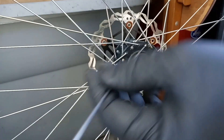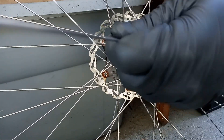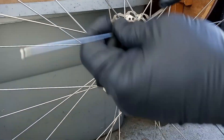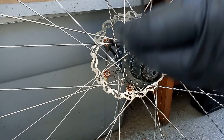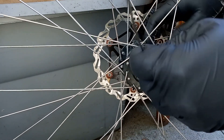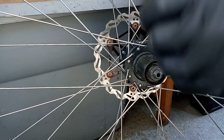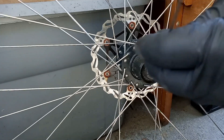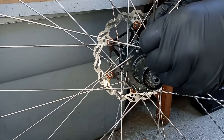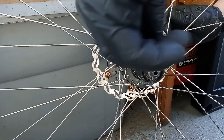Got our old spoke out; we're going to try to get this new spoke in here. I've seen some guys where you could kind of bend them out of the way — you could bend it so that it has a little radius, which will help you feed it around the other spokes. Don't put a sharp kink in it though. This is just a temporary fix; if you have multiple broken spokes you probably should relace your wheel, but this should be okay.